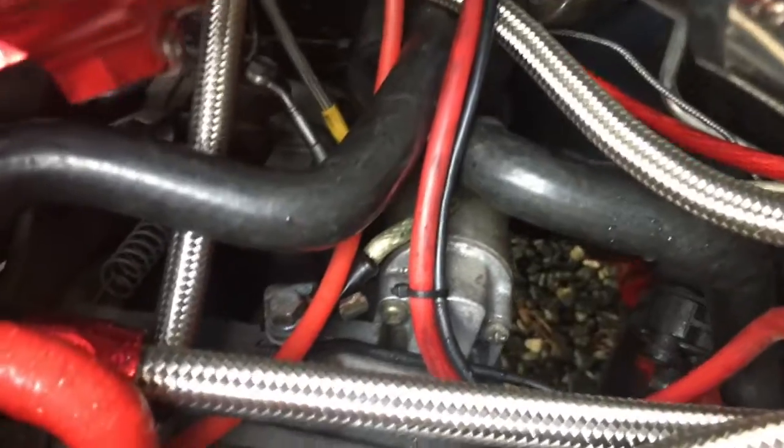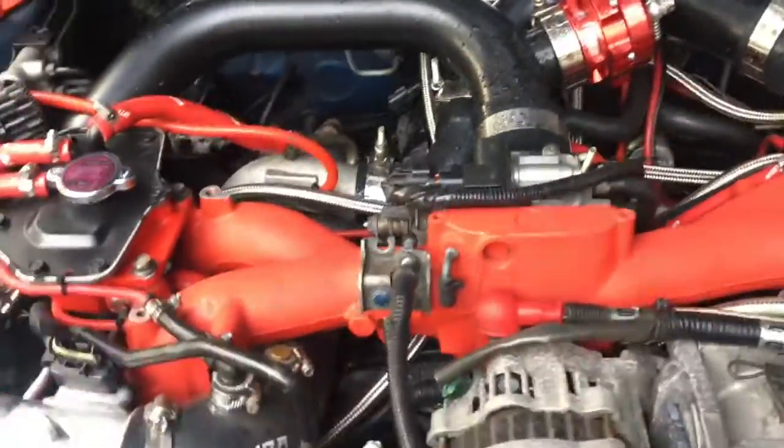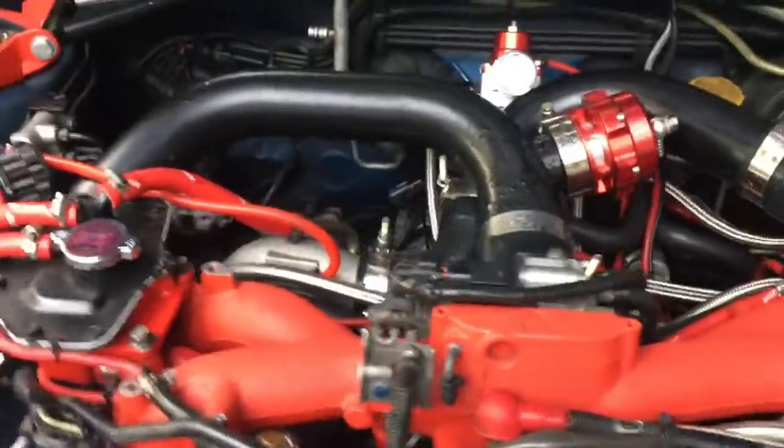It is a pull type clutch, so I was able to use the WRX slave cylinder that it came with and lines and everything, so I don't have to re-bleed my brakes. The starter would hook right up, but I just used the starter it came with because it was in a little better shape. And then I used the WRX flywheel and clutch just because I had just bought that at the end of last summer, and it only has a few thousand miles on it, and it holds all the power that this can take at the moment just fine. If I go to more power, I may have to upgrade it to an STI one. But again, the WRX clutch does bolt right up.